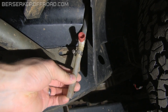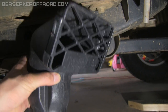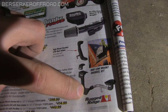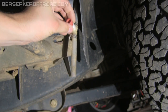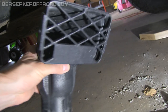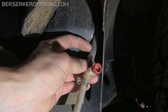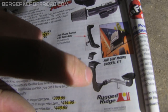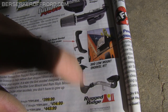Another thing I don't like about the snorkel is the drain. When it rains, water gets into the intake — ironic, I know. You get a snorkel because you don't want to deal with water, and yet you have to deal with water. Rain gets into the snorkel and fills up the tube that's behind the fender, going down the tube and filling up a little reservoir in the snorkel. They give you a drain so you can open it and let the water out. Problem is, I got mud inside my snorkel — not only water but mud and rocks — and as you can see, it's full of mud all the way to the cap. The only way to get it out is to take my fender off, get that piece back out, and clean it with a hose, which is going to be a huge pain because it's already siliconed to the rest of the pieces.